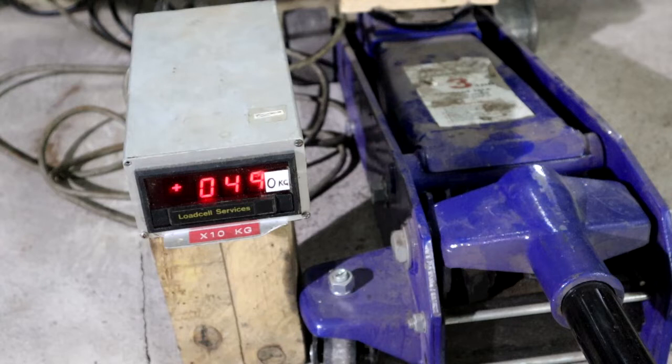Before someone thinks a little bit further ahead, let me say it - that includes the unsprung weight. That's the weight of the front axle, the shock absorbers, the mudguards, the disc, the brake assemblies, etc. So all the weight that is not actually moving - that weight stays on the wheels, so it can't be included. We need to actually subtract it from this reading.